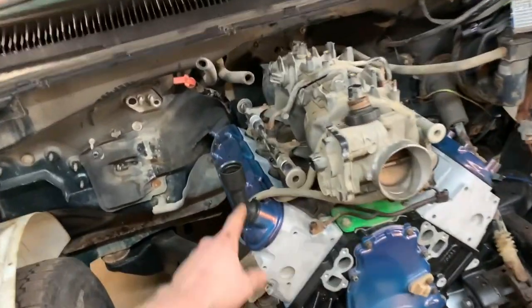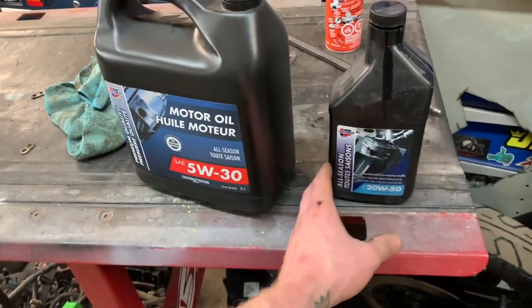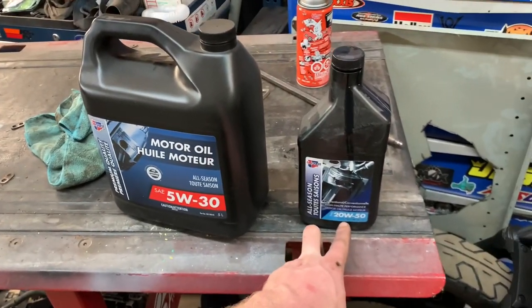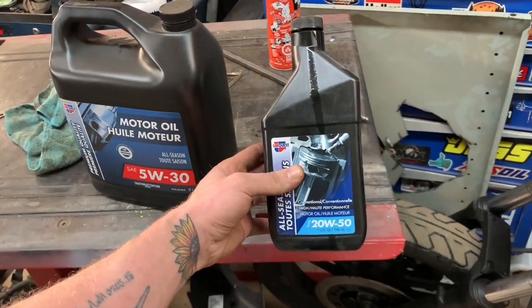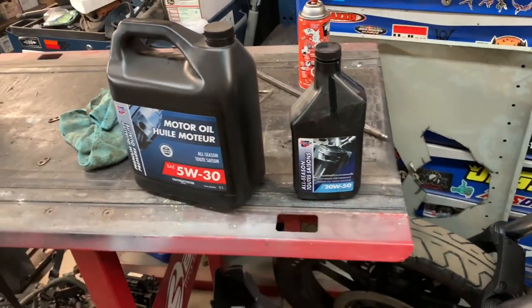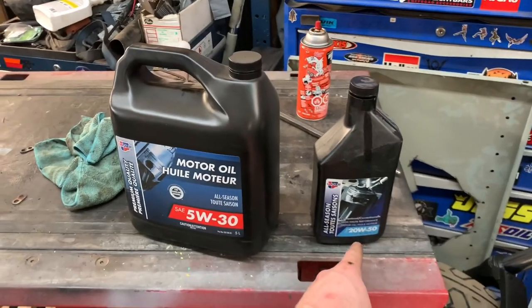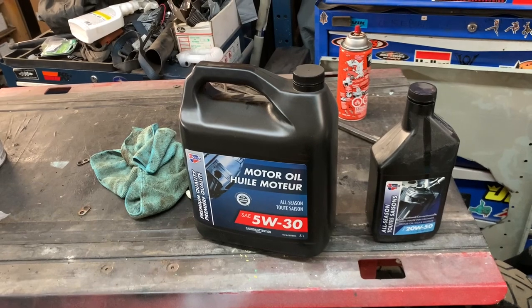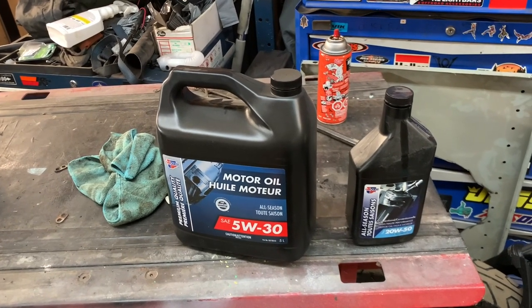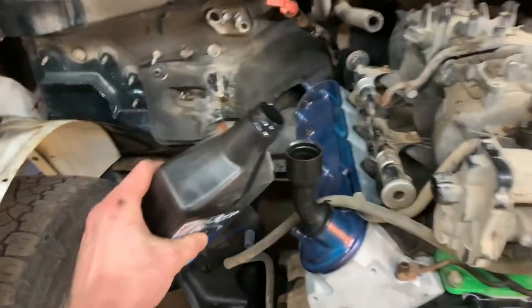This is kind of a day. Look, I put on the little spout. And we got some mathing to do, some numbering. So I grabbed a bottle of 20W50 because it was the first thing I saw on the shelf, which in hindsight, probably a bit thick. Anyway, that's what I poured down over the rockers and stuff when I was installing them. And it takes 5W30, so we got 5 5W30s and 1 20W50, so I wonder what viscosity that's gonna make. Is it gonna be like 13W40? 13W? Let's just call it 15W40, and we're good to go.